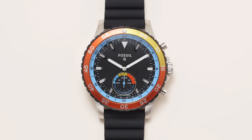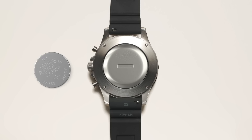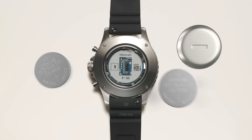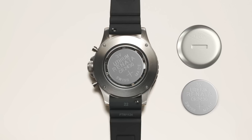There's no charging required when it comes to our hybrid smartwatches. When your battery is low, both hands will point to six as a one-time notification. You'll need to change out the battery every six months or so, depending on usage. Use the provided Q-tool or any coin and insert it into the back of the watch, turning it counter-clockwise to open. Then replace the CR2430 battery, which is available at most retailers.